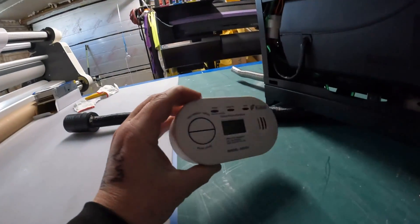One very important thing I'd like to mention if you're taking on a project with one of these diesel heaters: arm yourself with a carbon monoxide alarm. A lot of people probably don't bother, but anywhere there's an exhaust you can have issues. From a personal point of view, I've actually had a family member lose their life to carbon monoxide poisoning on a fishing trip last year, so definitely get yourself a carbon monoxide detector and alarm — you cannot be too safe.